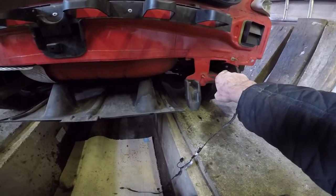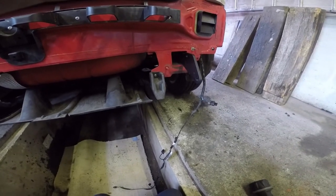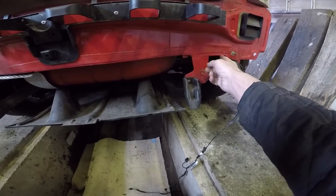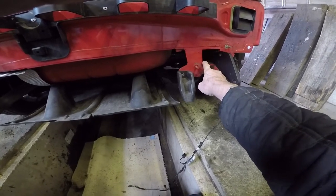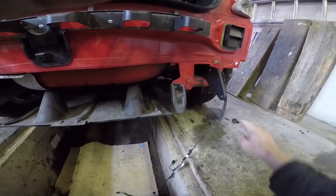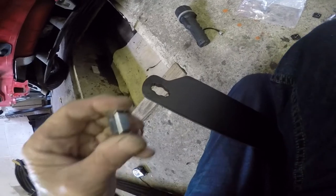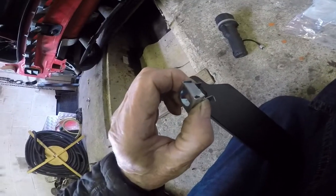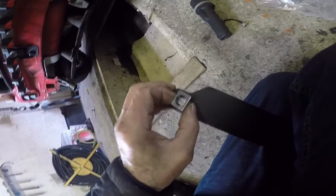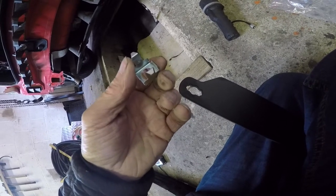When I put the nuts on the back of this, I'm also going to put some wax oil or grease on these to preserve them. One thing I didn't like is that these are going to be exposed to water — before they were covered, so maybe I can do something about that. To locate them into these holes, you've got to make sure you don't damage them. Press them in like this, locate them in there, make sure you've gone the right way around and push them in. These will hold the nuts in place while you push the bolt through the chassis.